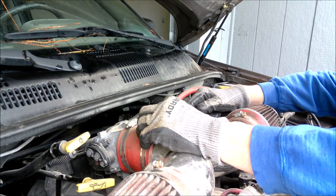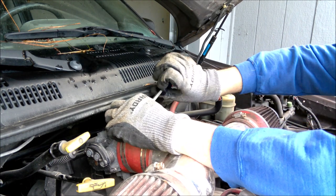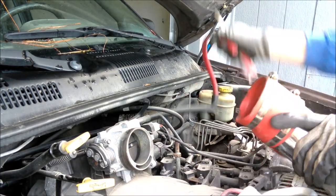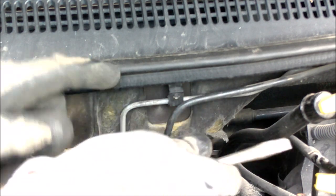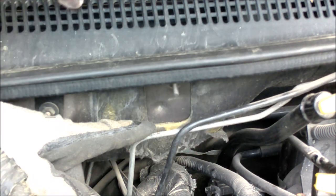Now, to begin this installation, you must first remove your intake. The factory intake box does require a few more bolts, not quite as easy as this one, but remove your intake, and then you can move on to the firewall, where the factory brake line is retained by this clip. You can pop it out of place. Then you can actually remove that clip, exposing the stud there on the firewall,